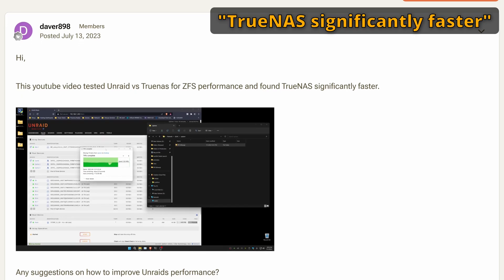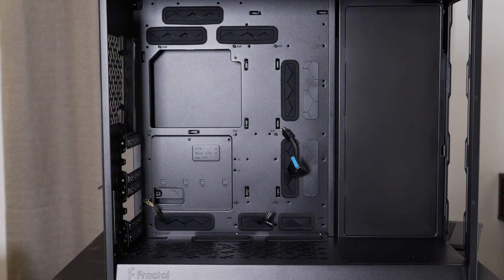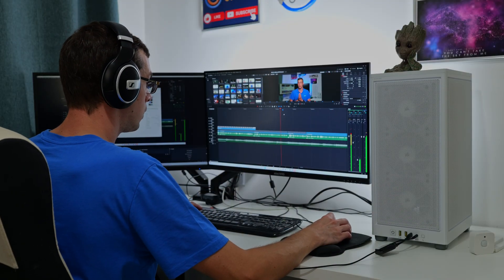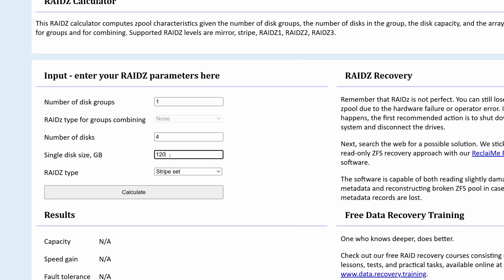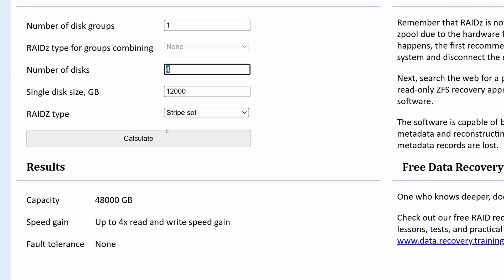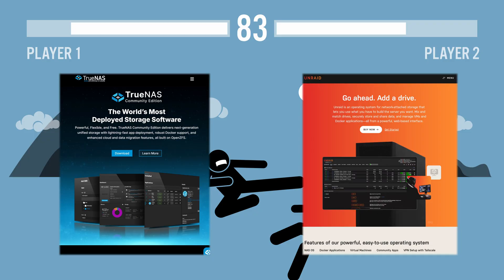There is though a downside of UnRAID, which is that things are slower — a hard drive might top out at around 250 megabytes per second, which translates into around 2 gigabits per second over the network. That's not too bad because I'm going to be video editing locally and then putting projects in here for archive purposes. But sometimes I might need to load up an old project and do video editing over the network, and 2 gigabits per second isn't always the fastest. With TrueNAS, if I had four or five hard drives in a ZFS pool, performance can be really good — more akin to RAID 10, with disk redundancy but also increased read performance. So in cases where I want to edit over the network, UnRAID being capped at around 2 gigabits per second is a tick in the box for TrueNAS.